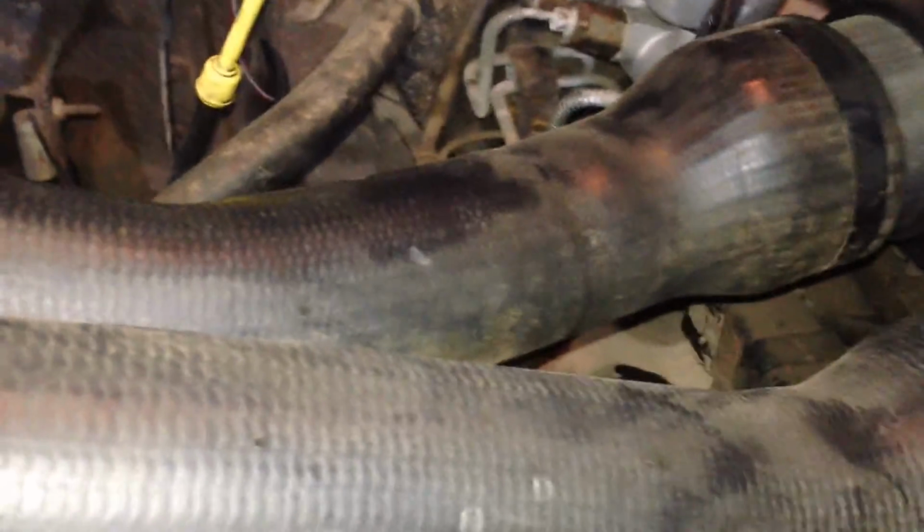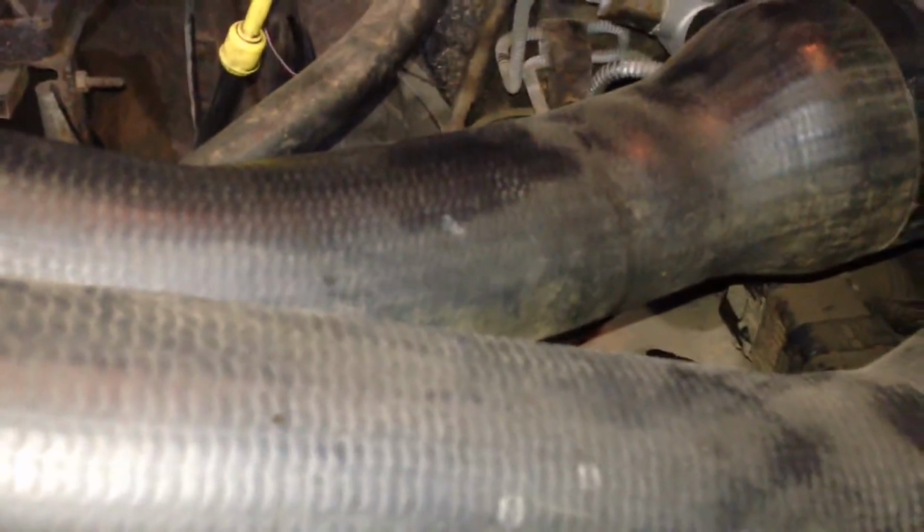And you can leave the spring out if you want, but it removes the RABS, so that could be an issue later on down the road. So always put it back in. There we go, squirt. Can't really see what I'm doing past my intake. So I'll show you one more time. I'm gonna just continue this process until I get it stiff, and I'll show you what it looks like when it's stiff. So push the brake, comes up.